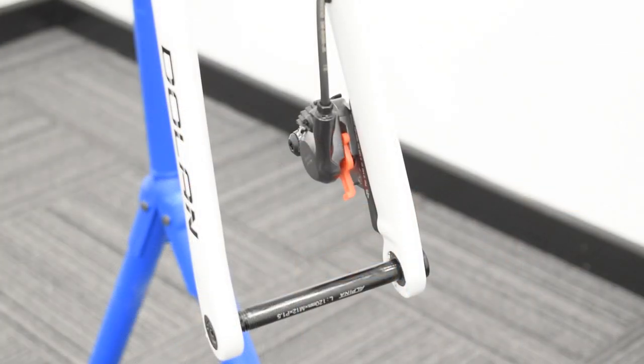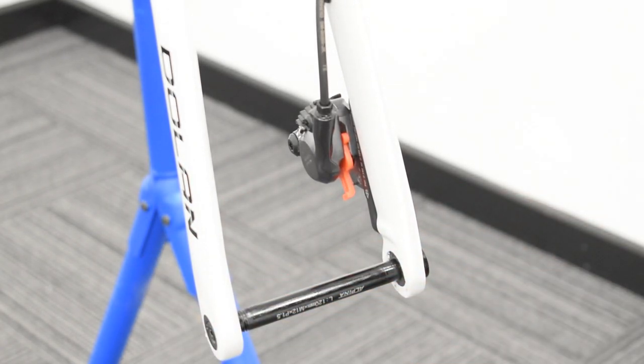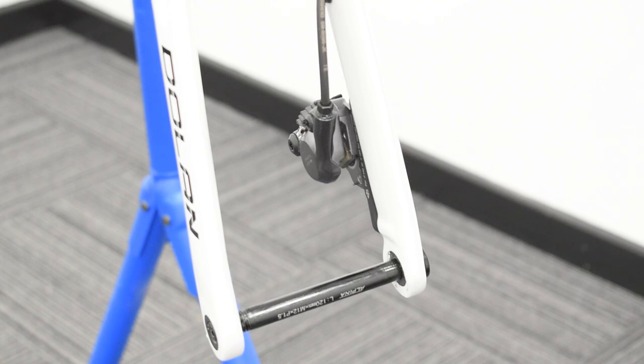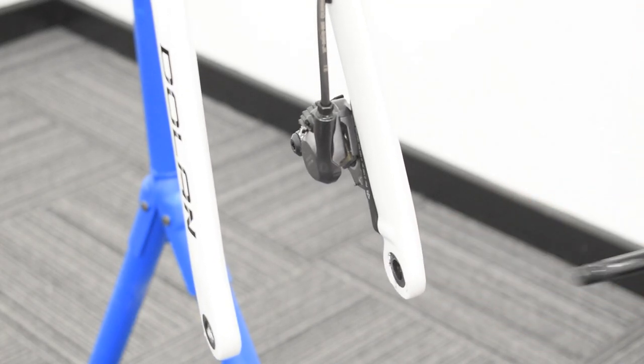Now that the tape's been cut away, this is what your forks are going to look like. You've got your through axle here which should already be fitted into the fork — you'll need your 6mm allen key to remove and refit it. You'll also notice a little red spacer between the disc brake calipers; this is put there so the brake calipers don't squeeze together accidentally in transit. To remove it, just unclip it and put it to one side. Once removed, it's very important you do not squeeze the front brake lever until the front wheel has been fitted. Then take your allen key and remove your axle by unscrewing it — it should just slide out once loosened.